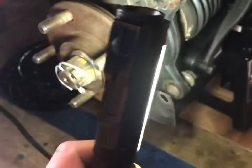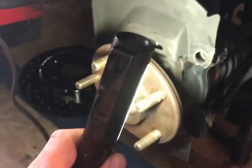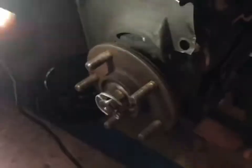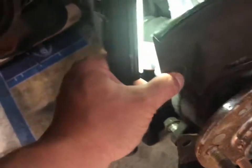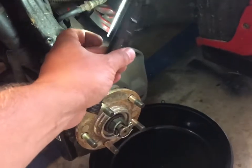To install these Wilwood brakes, I tried to put the rotor on and it definitely hits the dust shield because it's a much bigger caliper. So instead of taking the whole thing off, I just snipped it here and there. Then I'll take this bolt out — guessing it's like a 10 or 12 — and slide them off. You can actually reuse them, so they're good to keep. This one was already cut from when my car was all-wheel-drive swapped using a 95 donor car.